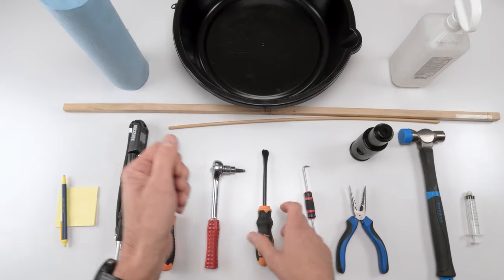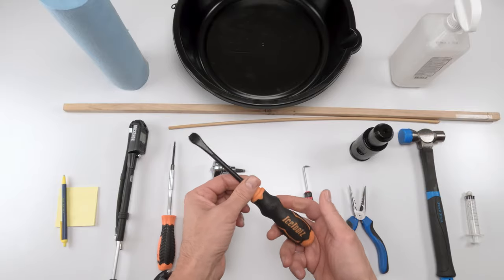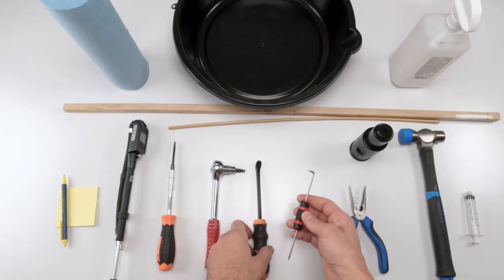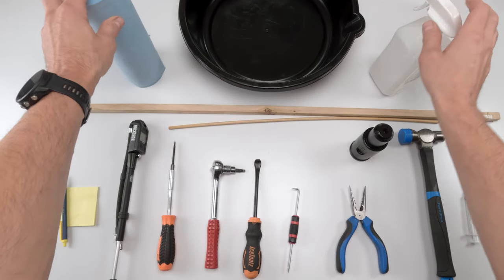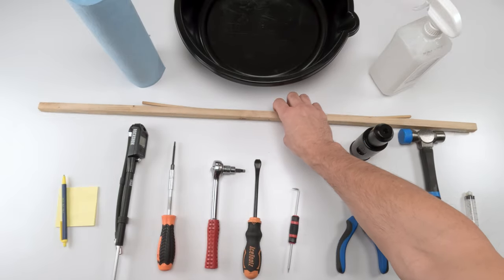From there, we're going to separate the lowers. We're going to need a lever of some sort. I use this tire lever from Ice Tools. It works great in order to take out the wipers, right? When you take out the wipers, a pick comes in handy in order to take out the foam rings. From there, we're going to clean the inside of the boots. To clean the inside of the boots, you need paper towel, alcohol, dowels, and a rubber band. You'll see why the rubber band.